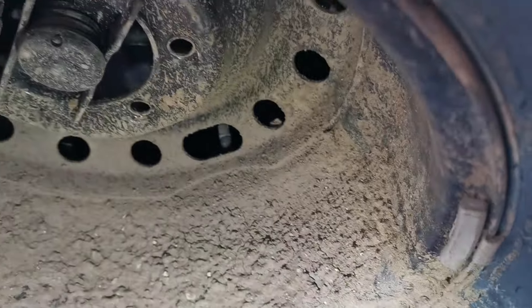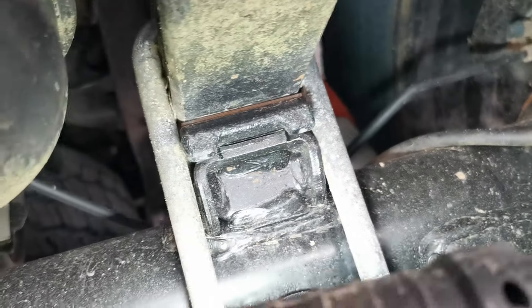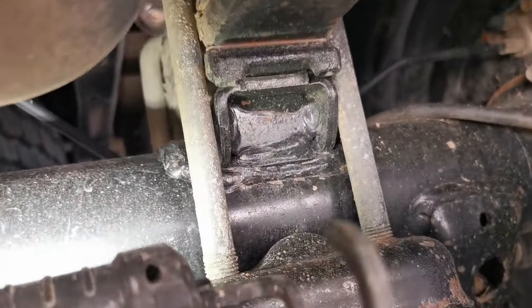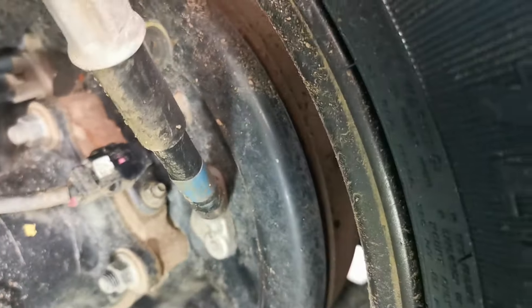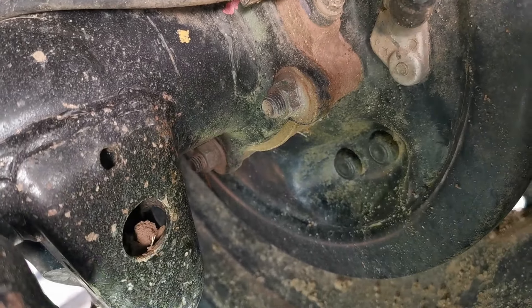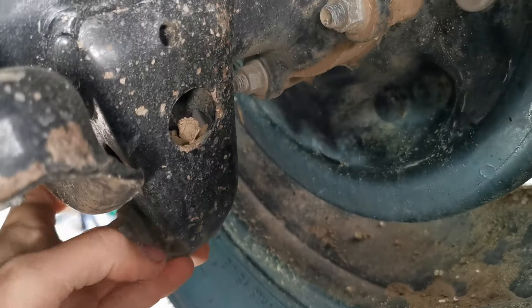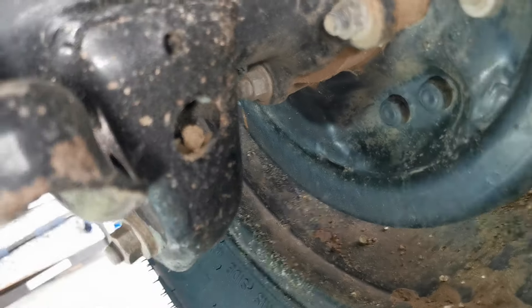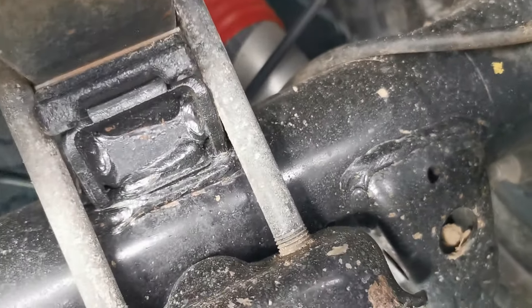The spare tire — that's an obvious one. Scooting forward here — right here was a bad one. Mud loves to collect by the leaf spring and in behind the drum brakes, and right in there there's still mud. You know, it's kind of smart they have a drain hole down here, but if that's clogged then that mud is just going to hold water and eventually rust. So gotta make sure to get rid of that.